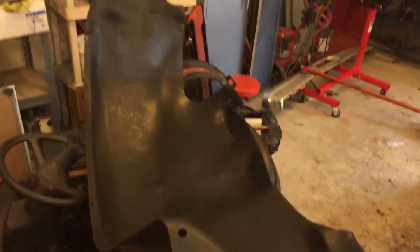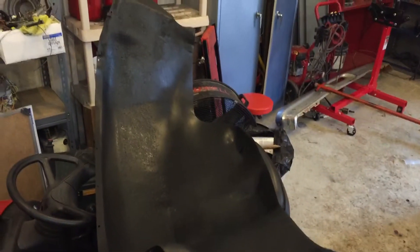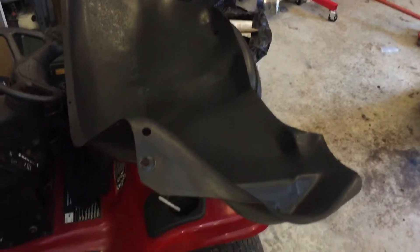I have — I don't know if you can tell this at all — there we go. Bed liner spray on these fender aprons. They had some tar stuff on them I couldn't get all the way off without tearing them up, so I just coated over them. They'll be fine once they go on there.